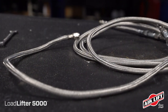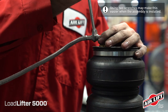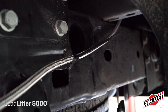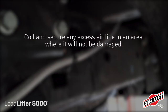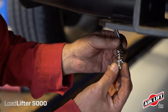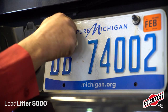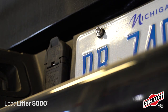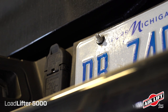If you're installing braided stainless steel airlines, tighten the airline hex nut finger tight, then use two wrenches to turn one additional flat, or one-sixth of a turn — do not over tighten. Use zip ties to secure the airline along the chassis every six to eight inches, leaving some slack. Coil and secure any excess airline in an area where it will not be damaged; note that braided stainless steel airline cannot be trimmed. Place a nut and star washer on the inflation valve and push it through the inflation valve hole, then use a rubber washer, flat washer, and nut to secure it in place, and twist on the valve cap. Before getting on the road, inflate the springs to 50 PSI and spray all airline connections with a soapy solution to check for leaks.